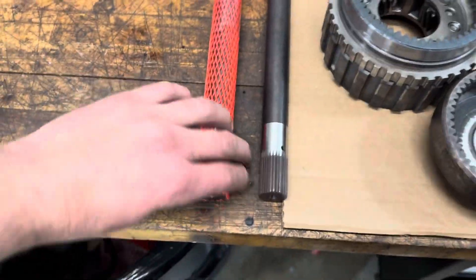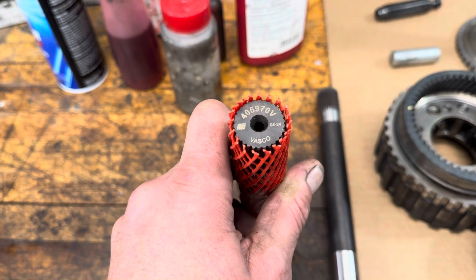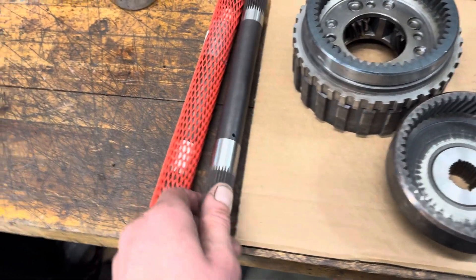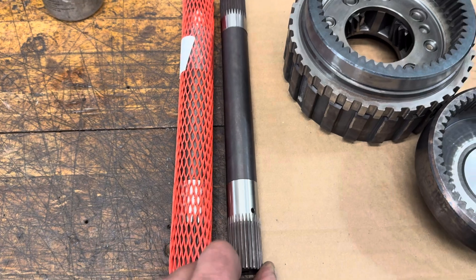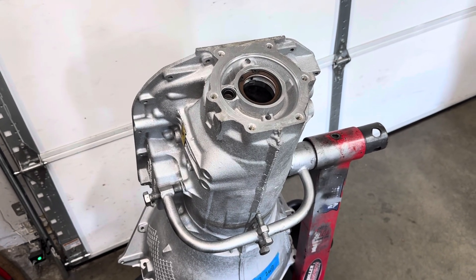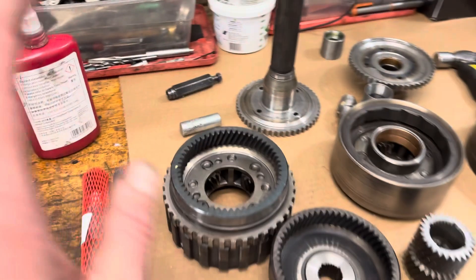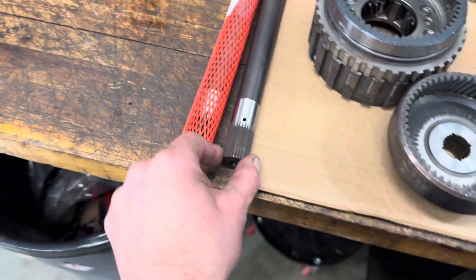I have moved to these ATI VASCO shafts. ATI is sourcing this VASCO material for a TH400 main shaft. A TH400 main shaft allows you to change some of the lubrication of the 4L80E to lube front to back, which in my mind is a better setup. I think the early style lube system was more advanced than the later style — it just kept the planets alive and kept the bushings alive better. You can convert over to that by using a late style output shaft with the hole in it, some changes to the bushings, and a hollow main shaft.